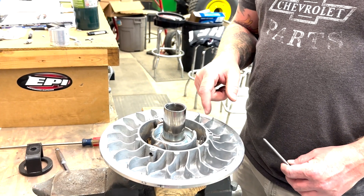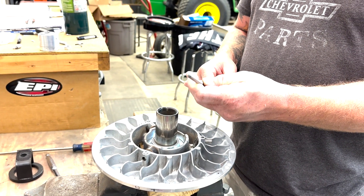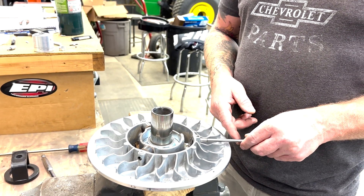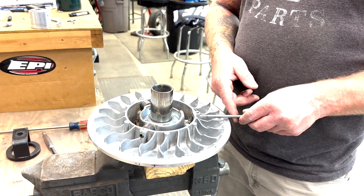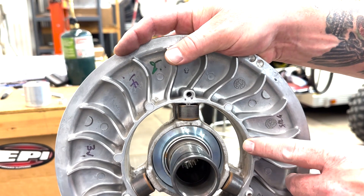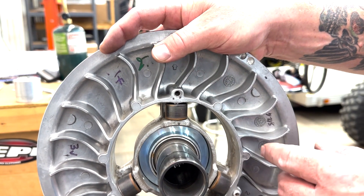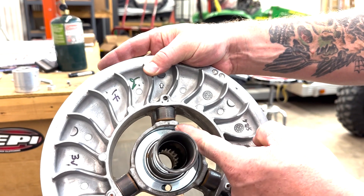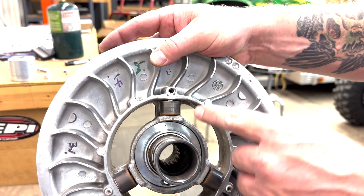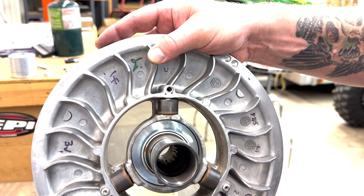When you're going to reinstall your roller and pin, what works best is one of these semi self-centering roll pin type punches, because it fits right into the end bore of the pin and allows you to keep it centered when you're tapping it back in. We've gone ahead and skipped the part where we pounded the pin back in — we had one person hold this while the other person punched the pin through, just to make sure you get the roller. One important note: don't pound the pin too far because you'll blow out the back side of the clutch and possibly crack and damage it. You just need enough space to get the small screw threaded back in that retains that pin.